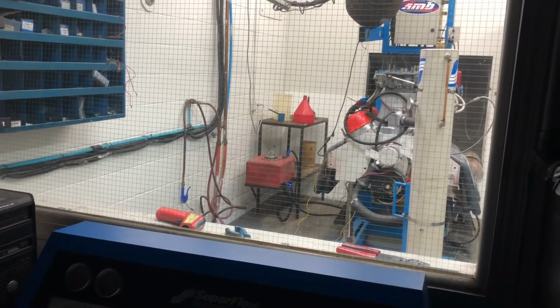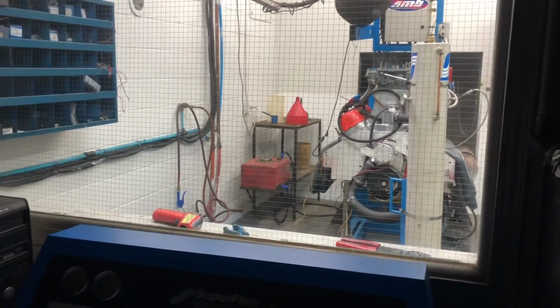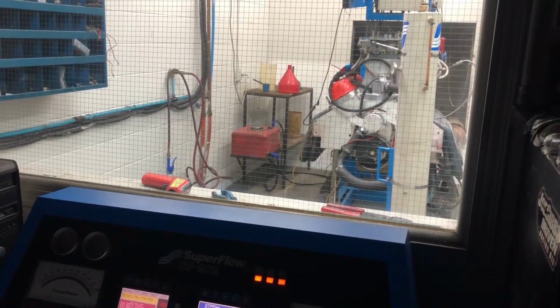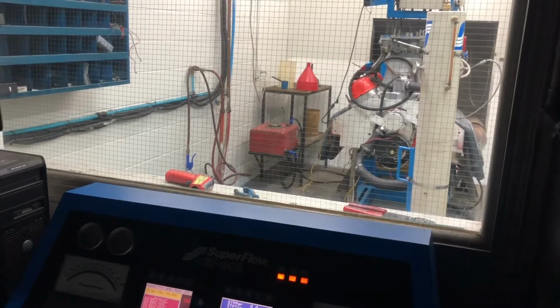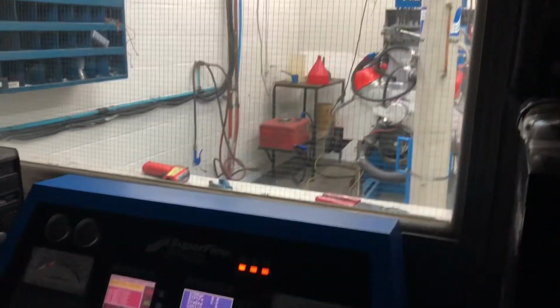I'm just not sure about that mark we scribed on there with a marker. I don't think that's necessarily perfectly top dead center, you know what I mean? So I'm thinking that's more of a reference mark than a real one. So 37, one degree at a time. If we lose, we have to back up. If we win, let's go two or three and we'll see what we gain or lose. Because we're two or three shy of where we started out.